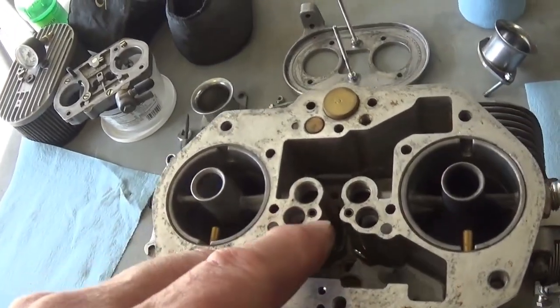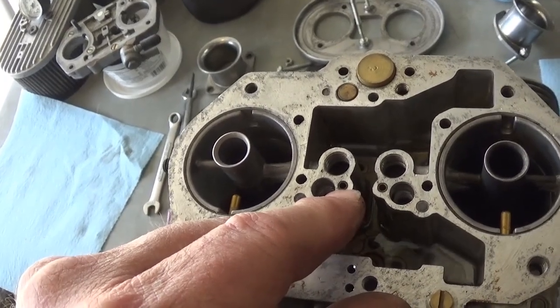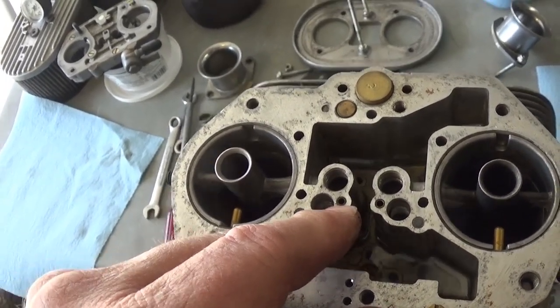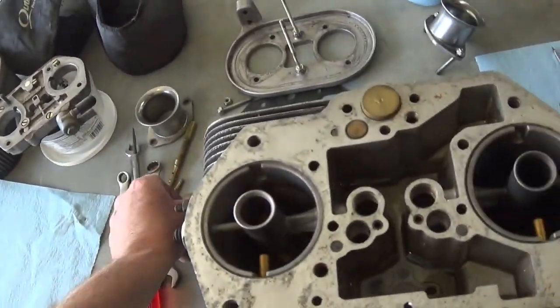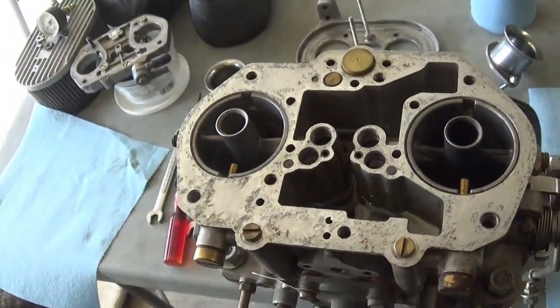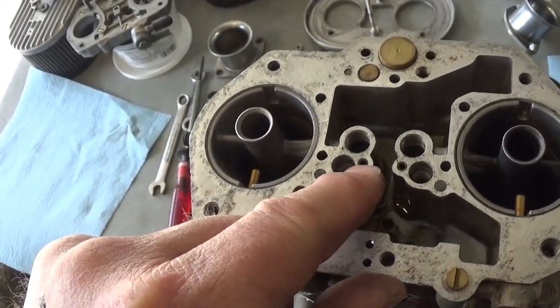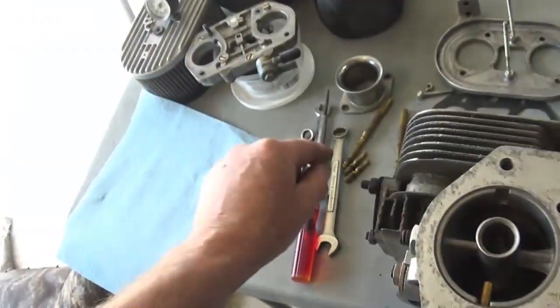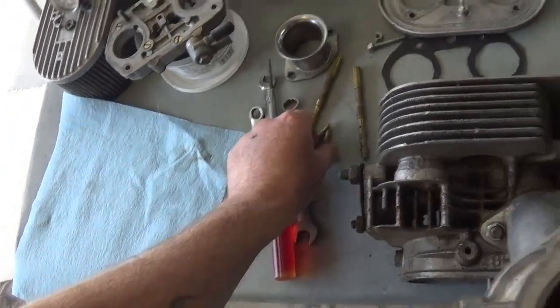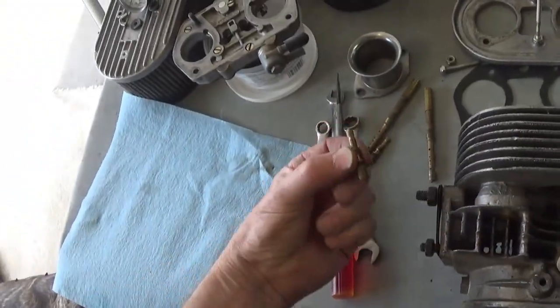it rarely happens, but it's possible that a grain of sand or something can get lodged in here, and this is how particles can get in here. Small particles, you know what the dirt and sludge is that you see in carburetors? That stuff can go down this vent hole into that stack and create a blockage here. If this is blocked completely, it won't allow flow.